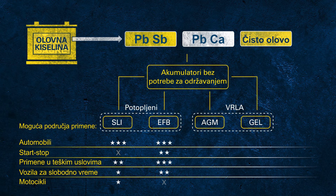The EFB battery is an enhanced battery designed to support basic start-stop systems, but it reaches its limits in more aggressive start-stop systems or cars with many electrical consumers. AGM provides outstanding performance for all applications, including high-demand electrical systems in luxury cars, SUVs, or fully equipped long-haul trucks with an electrical parking cooler. Gel batteries are not very common in automotive applications but are often used in leisure or motorcycle applications.